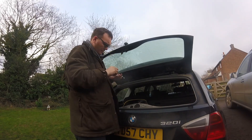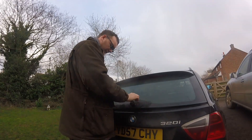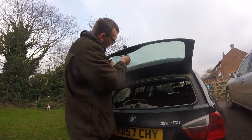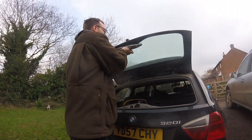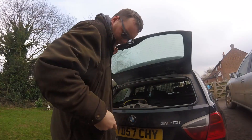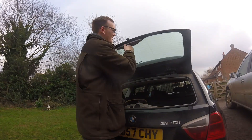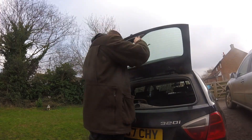After putting all this in the back window wiper still didn't work, so I had to go to Halfords and get a load of big fuses and micro fuses. As soon as I replaced them, stuff started working - the window wiper, mirror, horn, no end of stuff. If yours still doesn't work after doing this, double-check your fuses, because what I've often found is there's nothing wrong with the part - it's just the fuses. With a micro fuse it's hard to tell if it's blown anyway.